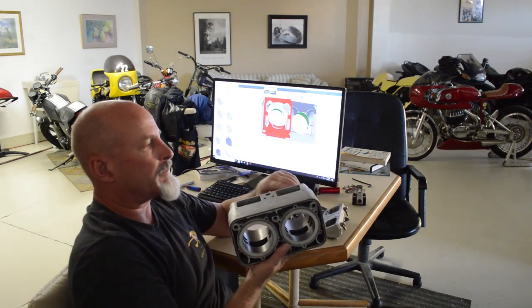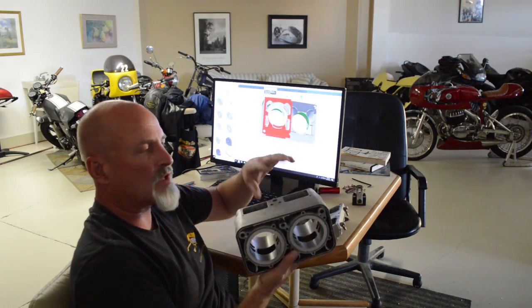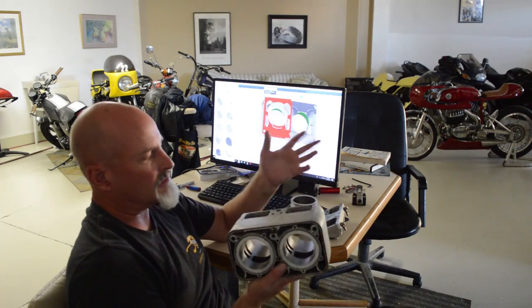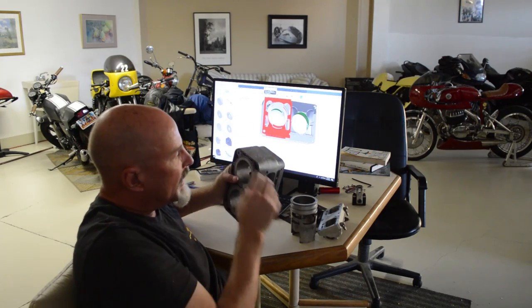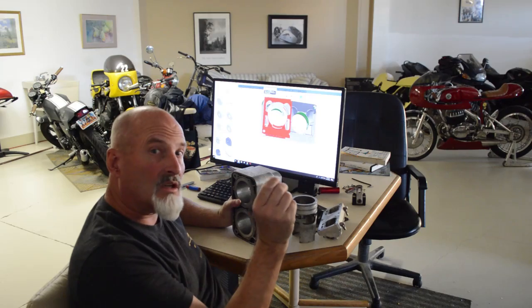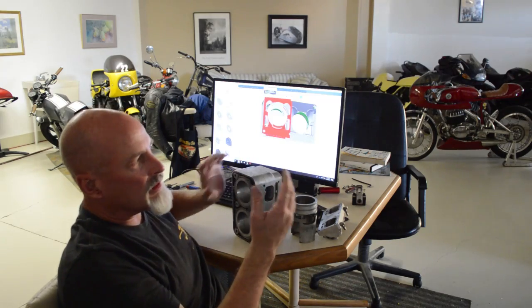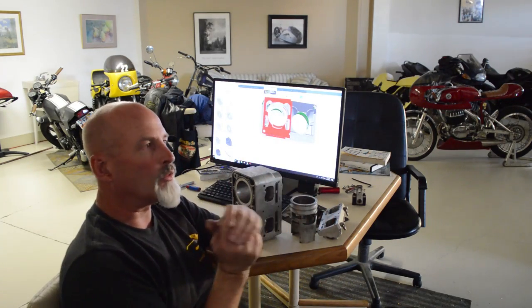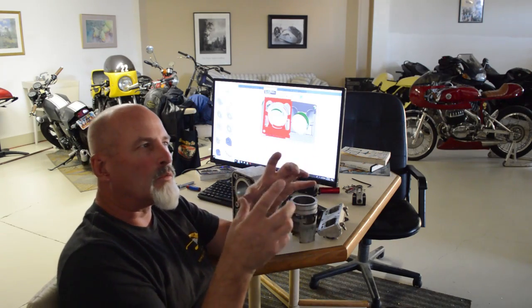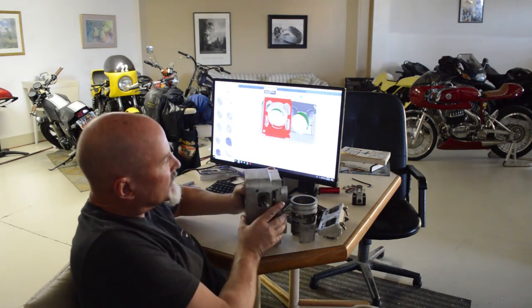There was no way to send it back in and have it re-nicosiled in time. There's so much time involved in machining these that I get one done a year — I'm a working guy with other stuff going on. To put a couple hundred hours into one of these is a monumental amount of work. That's why on this last engine I went back to iron — really thin iron to minimize heat retention. If I ruin a sleeve it's just a press fit, so I can push it out and put a new one in.